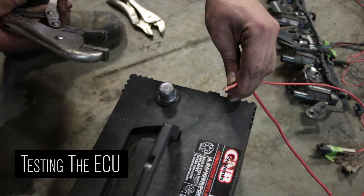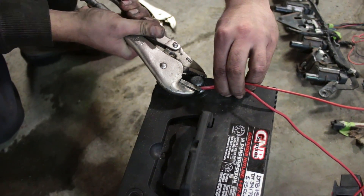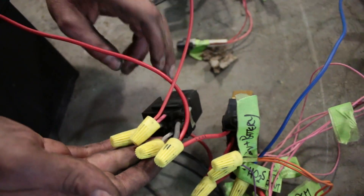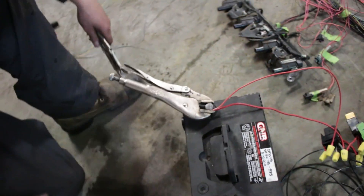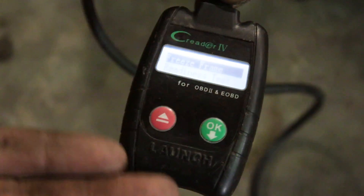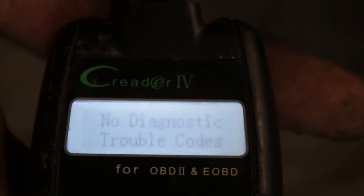One of these is your fused ignition positive voltage all the time, and one of them is your ignition wire. We have them run into the relay here — here's our power all the time, 12 volts, and here's our ignition. It runs through the relay. So by turning the relay on, you're applying power to the system. Then we take all of our grouped-up grounds and we plug them in. And right there, look at the code reader here that we have plugged into the OBD2 port — power it up and you can tell it's reading my computer, everything's okay. And then it says: no diagnostic trouble codes.